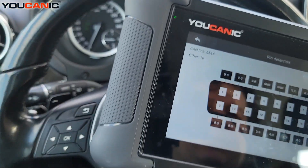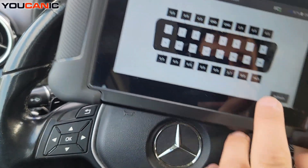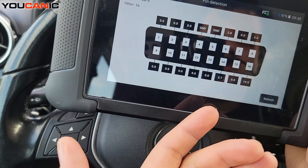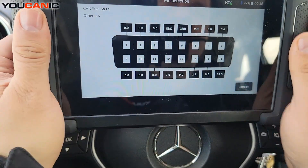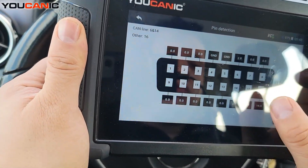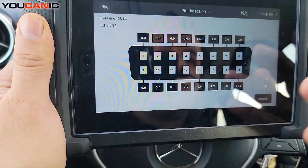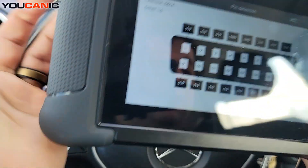A while ago I had a Mercedes that was not getting positive at all. It was the line that's supposed to come from the battery — the direct 12-volt line — it was completely dead. So instead of going through and trying to replace the whole wire harness on the car, I back-fed that 12 volts. What that did was allow the scanner to power up and communicate, and the communication is done through the CAN lines. And that worked. You have to be careful if you do something like that.